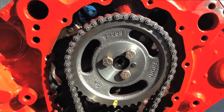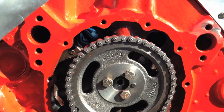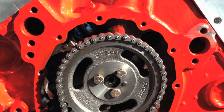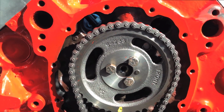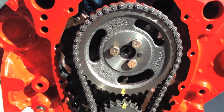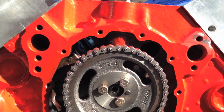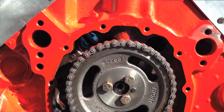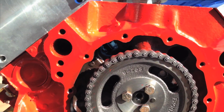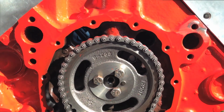Please don't send me any letters saying how bad Scotch-Brite is and there's 40 microns of aluminum oxide in it. It's going to destroy your engine, and so on. Okay? Trust me, there's a lot more dirt and garbage in the gas that you put in your car from the gas station than a couple of microns of aluminum oxide in here. Not to mention the fact that antifreeze, the reason you change your antifreeze every year is because after a year antifreeze becomes acidic and it'll eat all your aluminum and the intake and anything else aluminum in your car.